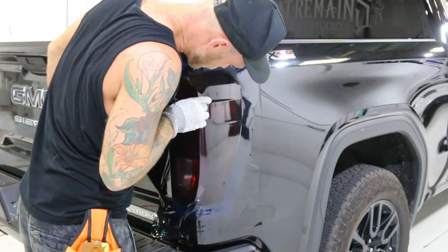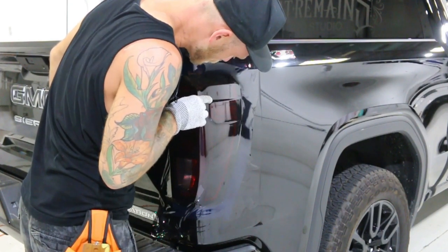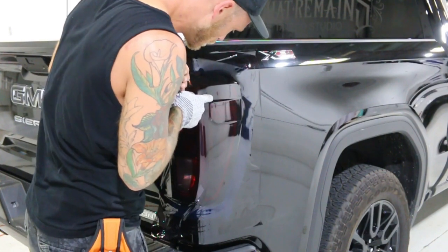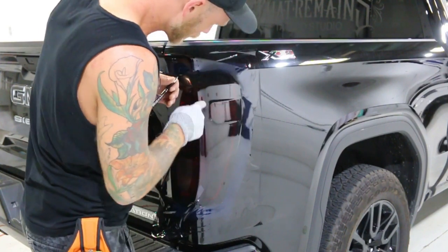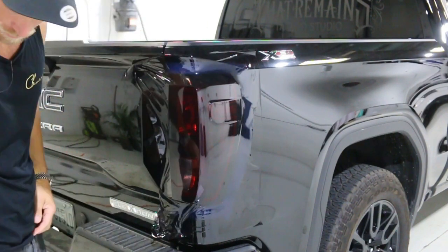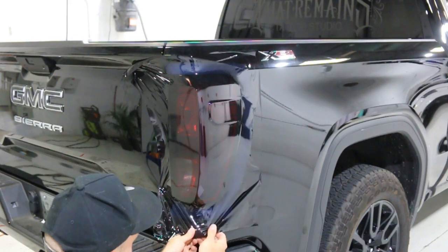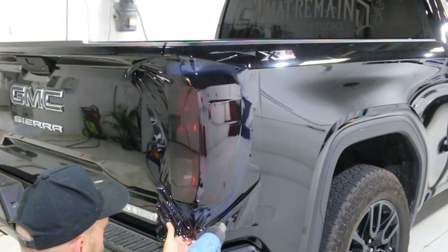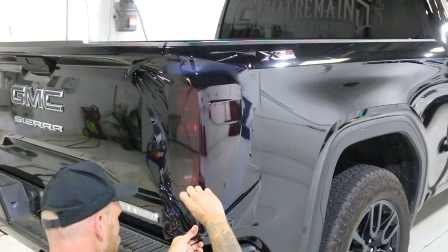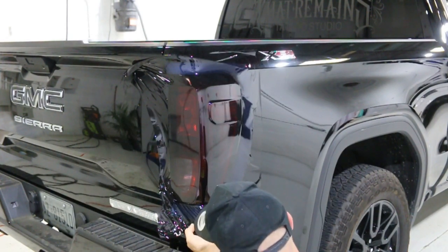Just be careful when we do this — truck lights can be pretty darn difficult, so keep that in mind. It's sealed up on me, so I'm going to poke one more hole. Looks clean. Time to do the outer edges. You can see how tight it is across the top and the bottom — this is very important for the purpose of the film shrinking down and around. I'm going to lift it here, heat the bottom, and just keep a little tension on it. It's going to shrink and pull itself down and around that bottom edge. If it's not doing this, you're going to end up stretching to the edge and it's going to fail.